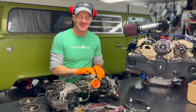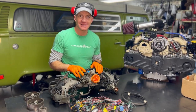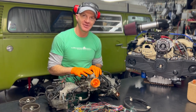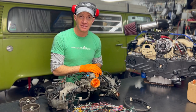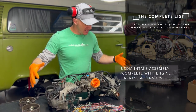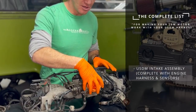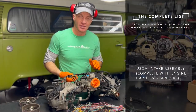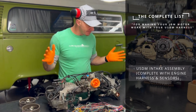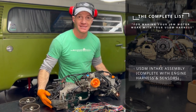Here's the final overview. I may have over-explained this in the first part of the video, but just in case, here's everything you need to do a JDM motor conversion for your Subaru conversion — whether in a bay window bus or anything else. The complete intake is the best bet. You may be able to get away with pieces and parts, but the complete intake with all its sensors and the throttle body — especially if you're converting from drive-by-wire to a cable-driven throttle — is one huge piece you'll need from your USDM donor.